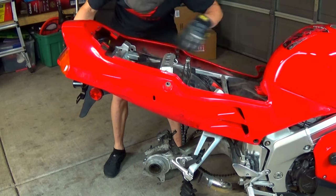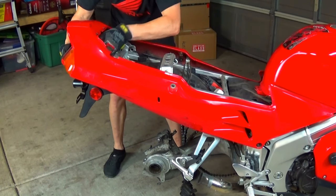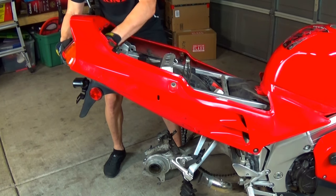There are four lights in the back of the rear fairing. Give each one a quarter turn and pull out. It's important to get them back in the same place, so I have labeled them to assist in reassembly.